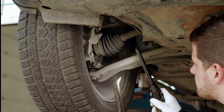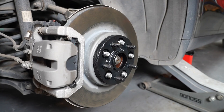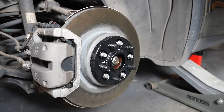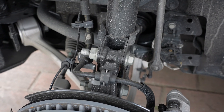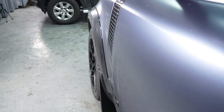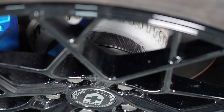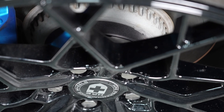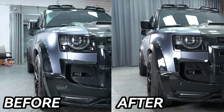Let's talk about the leverage effect. The thickness of the wheel spacers you add to your stock mounting hub directly affects the leverage. The thicker the spacer, the longer the leverage, which increases the load on the hub bearing. But here's a twist — if we consider wheels with less backspacing, we see a similar pattern. The effects on the hub bearing are quite alike. So adding a wheel spacer is pretty much like swapping to a wheel with less backspacing.